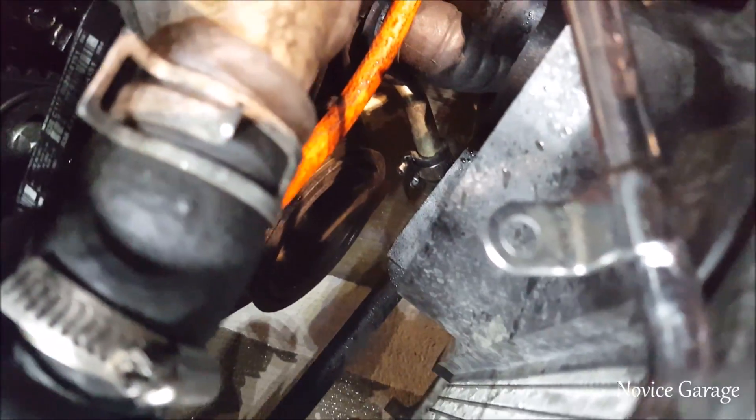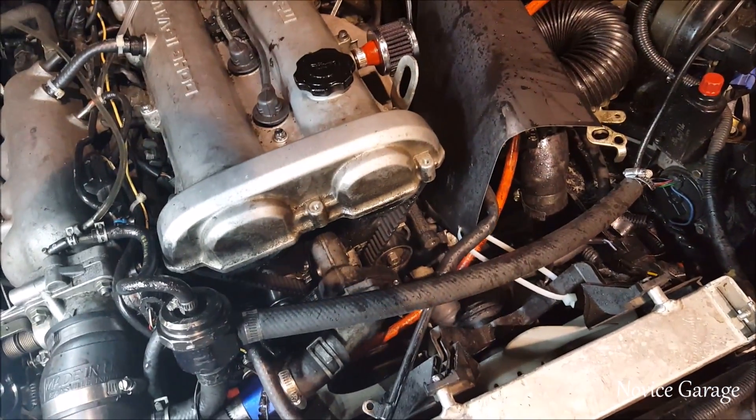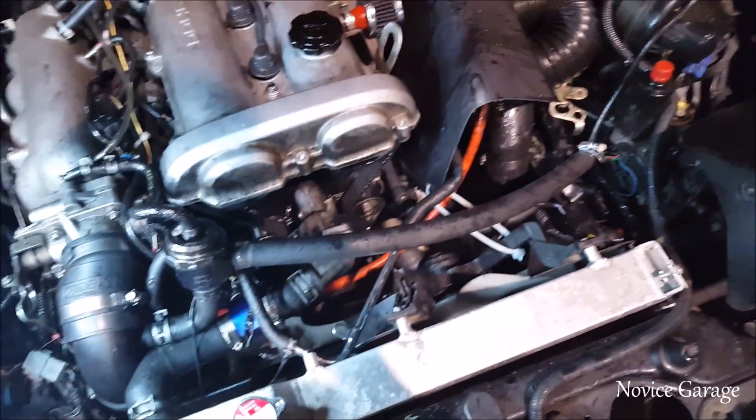It's hard to point at because I'm going to get burned if I put my hand in there. It's the hose right next to the crankshaft pulley that has not one but two hose clamps on it, and somehow it's still leaking. So I'm just going to try to tighten it down — I'm about 15 minutes away from home, so I'm going to try to just limp it home.